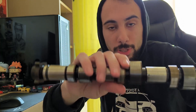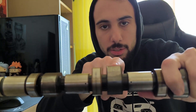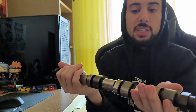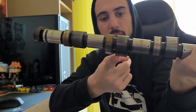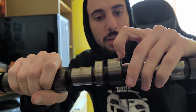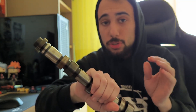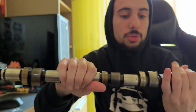My 3rd lobe is not as bad. You can see marks on the top of the edges and a little bit on the bottom — that's where the cam leaves off as it spins, hitting the rocker arm and then the rocker scrapes on the edge as it releases. My 2nd one is again wiped, but it doesn't really catch my fingernail — it's not severely bad. But once you see damage like this, unfortunately there is no going back; they will slowly get worse.